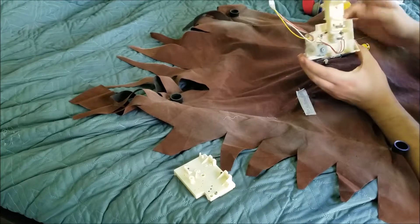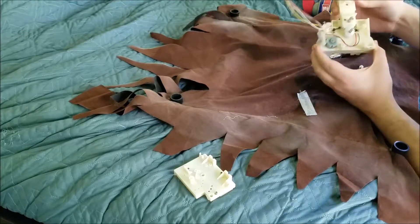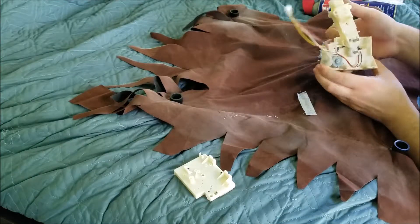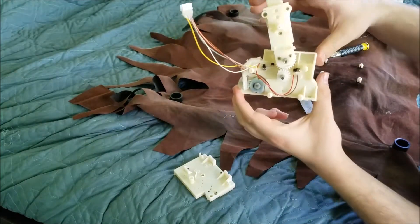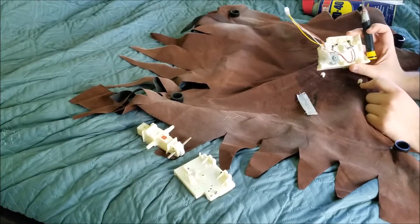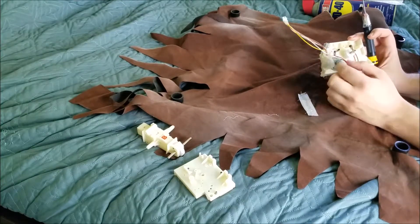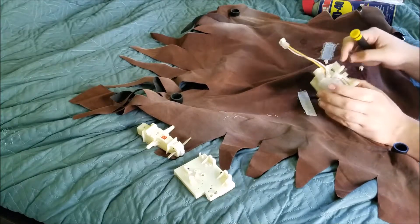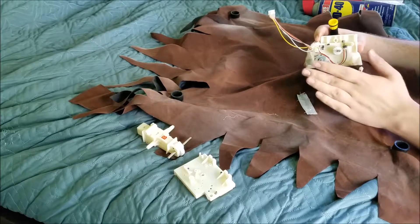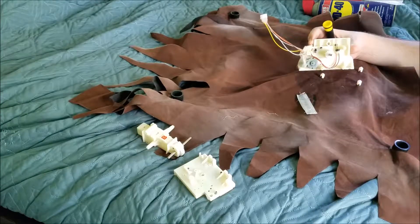Here's the gearing. As I move this back and forth, this gear moves. You can also see there are relay switches right here — when it goes forward it taps that one, and there's one back here that it taps going back. Something I noticed is that the relay switches are all connected — the motor and the two relay switches are actually connected to the same wire clip. I can't remove the motor without removing the relay switches. Make sure you know where these relay switches go when you're done, because if you don't, the animatronic will not work right and it won't function properly.